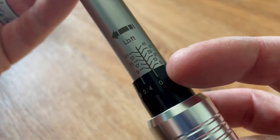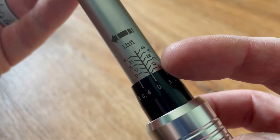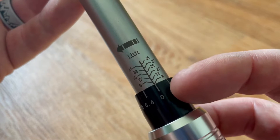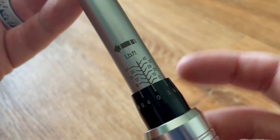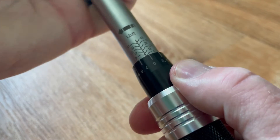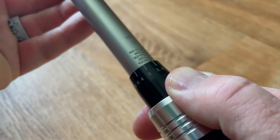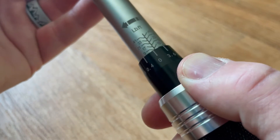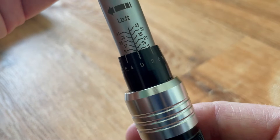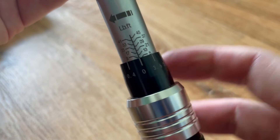You see how the lines are marked — they're in the down position, they angle up and then go out to the side. That's so you can see the number you're on, but know that it's actually going to be locked in at that bottom rate. What I'm going to do is pull down the lock ring, twist it to the left, full rotation. We'll come back around at zero. I'm going to lock that into place, and as you can see, we're now at five pounds of torque.